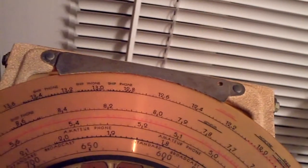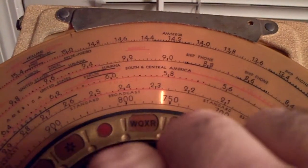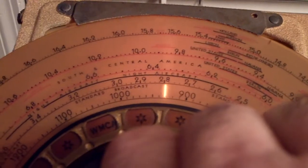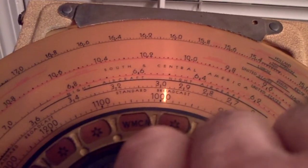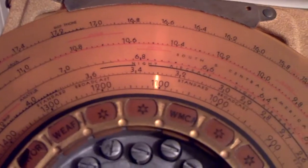Let me test out the dial. I installed the tuning knob — this is the fine tuning here in the middle. Sometimes this fine tuning slips, so I think I may have got oil on some clutch mechanism — I've got to check that out. I can see the Philco beam of light — that's what's cool.